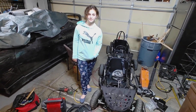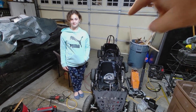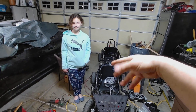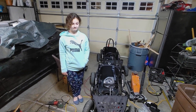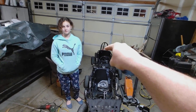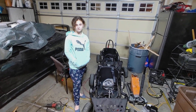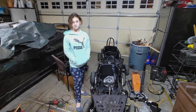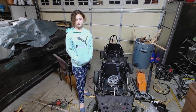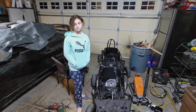So we had an absolute blast. We ended up doing 60 volts and got 18 miles per hour, upgraded to 72 volts — you'd think we'd get more speed, right? We didn't. We ended up at the exact same speed, 18 miles an hour. I'm guessing the speed controller in that electric go-kart has a cutoff and is limiting the voltage to the motor — probably some kind of overload protection. We did check the voltage at the battery and everything, and I just don't think it's coming out to the motor.